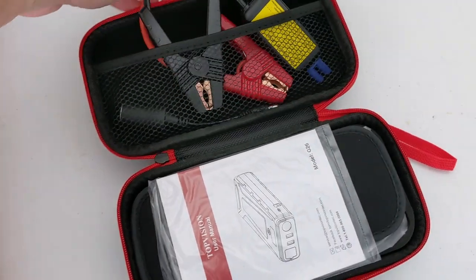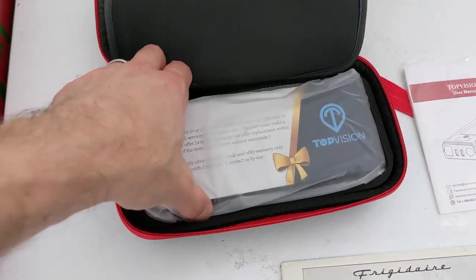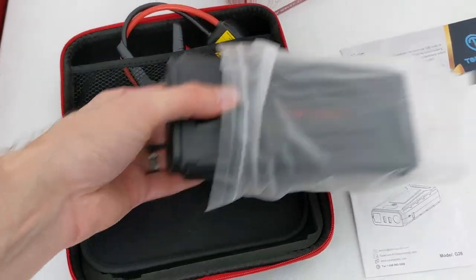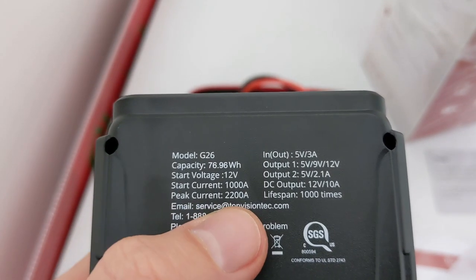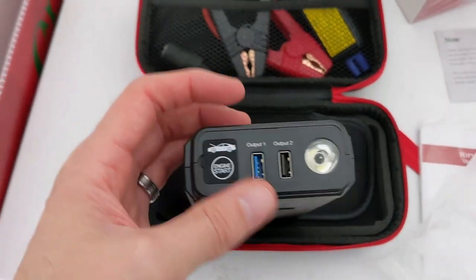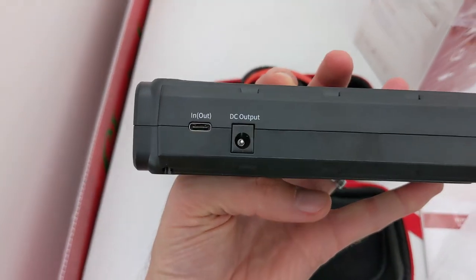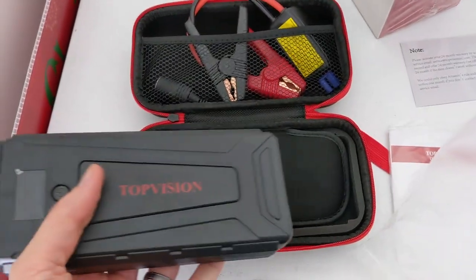It comes with nice leads. The packaging is really nice — it's all foam. It's basically a lithium-ion battery with a transformer in it that gets it all the way up to a peak current output of 2200 amps. There's a little rubber thing because that's where your 2200 amps is — you've got to be careful not to short that out. These are just your standard USB ports, but to charge the battery you're going to use the USB-C port, which I like — it's pretty modern. It doesn't use the old micro-USB style. You also get a nice bright LED.